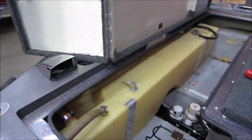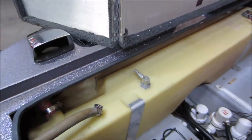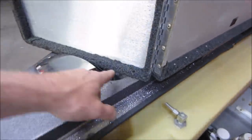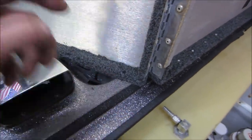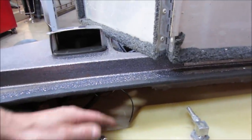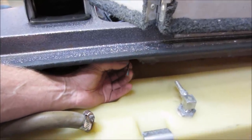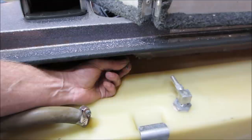So let's button up the gas tank, getting ready to put a new fuel line and bulb on going out to the motor. And it has a power trim and tilt switch right back there. You reach it from the other side when you're at the motor. And it did not go in the down position. And I do notice a wire is broken off. Not saying that's it. That could have broke off from me just fondling around with the gas tank. But let's look into that while we're here.